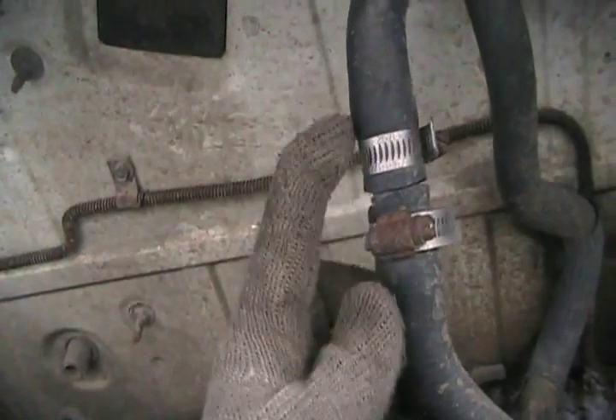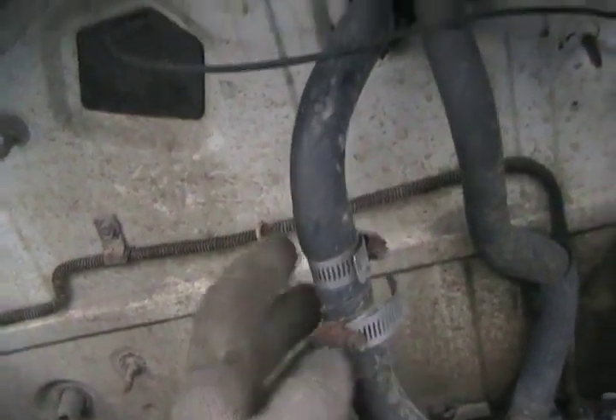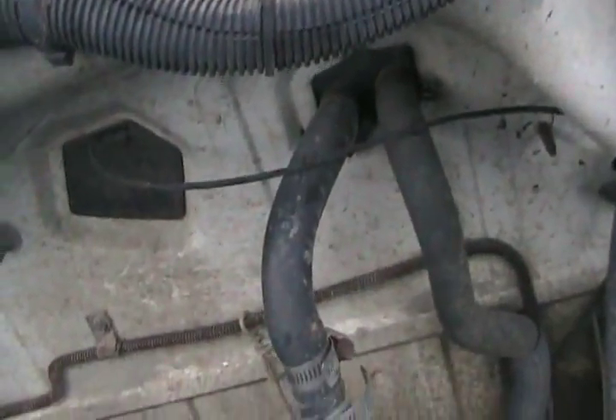The other, safer way to do it is cut the hoses in a handy place — anywhere under the hood that's easy to work on. Just slice them right in the middle, both hoses, and get two repair nipples that join the ends back together with a couple of clamps. As you can see, I've got a little coupler in there that I've repaired this hose with and two clamps. It's really nice when you have a couple pieces of hose to work with.